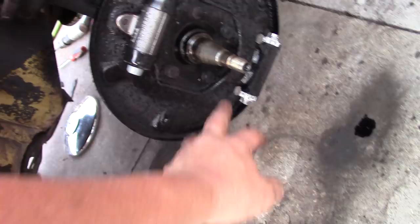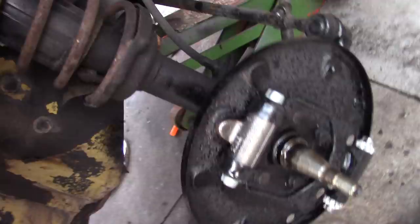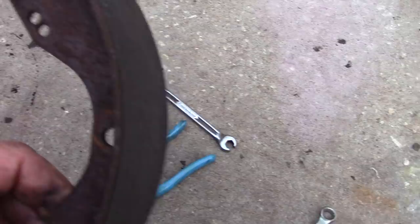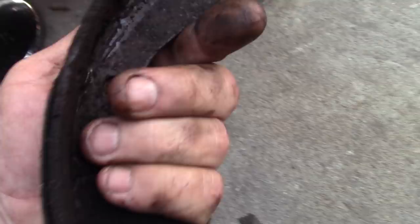On the front, we cleaned everything up, painted the backing plates, and freed and greased the adjusters. New Varga wheel cylinders — the front cylinder almost appears to have a Volkswagen part number right on it. The front shoes were pretty thin on both sides. The other side was actually a little thinner and had a seized-up adjuster letting one shoe contact the drum. You can see how thin it is — right to the metal. Perfect timing on the front brakes; I had made a notation that it needed them last time.